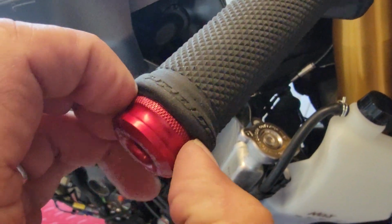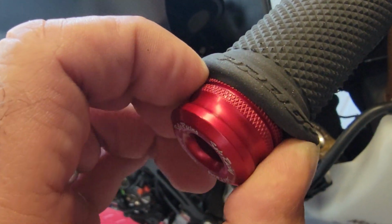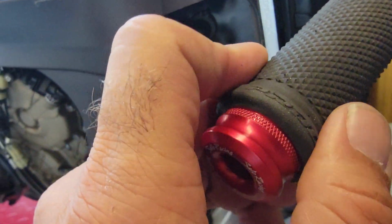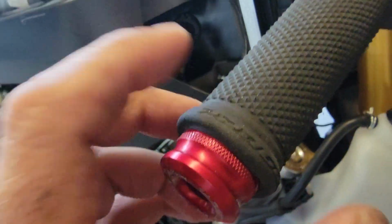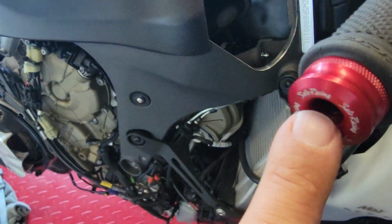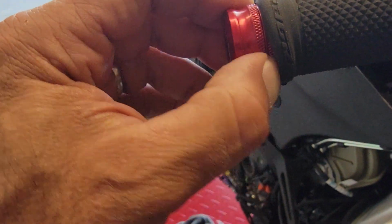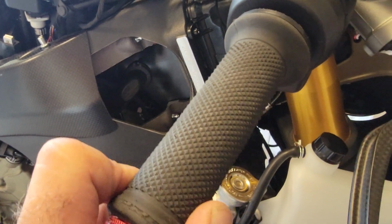They're sliding down, especially the throttle, and then ending up on the handlebar end, on the bar end. And what happened then is that the rubber stuck on the bar end, and the throttle can't close properly anymore. I already pushed it up here already, so it actually can. But you can tell already, it's sliding down and over this bar end, and that makes that throttle stuck. That's quite a feature, quite a safety thing, you know.